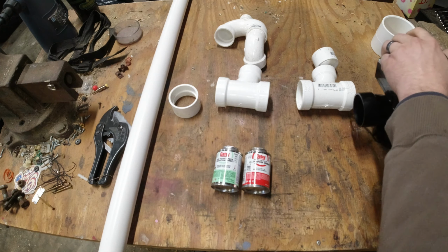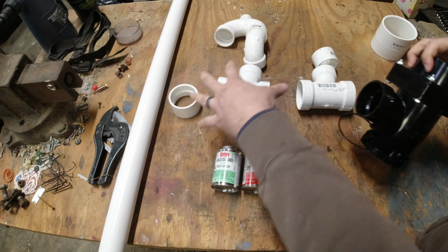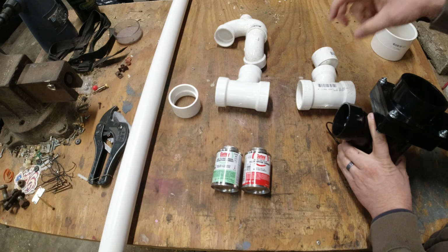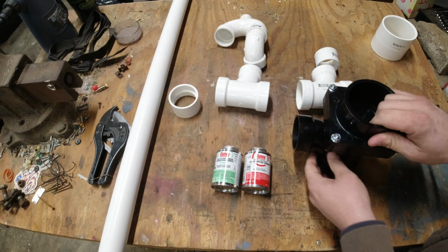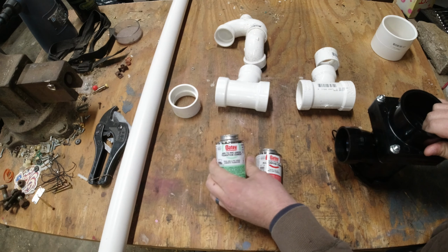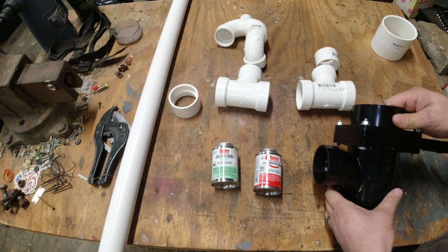This is where the black tank feeds into this, and then all this stuff comes into this side. This is a 2-inch connection here. You have 1.5 inch to the sink and the shower, but 2-inch otherwise. Then you got your PVC glue, and then you do need this ABS to PVC, which is going to be that transition with different couplers and stuff.